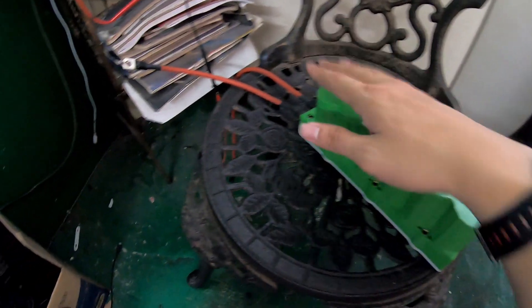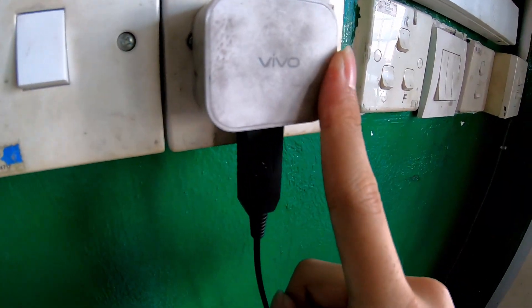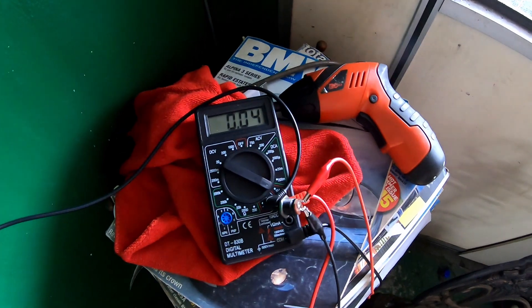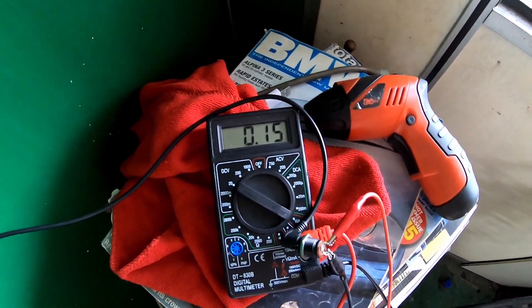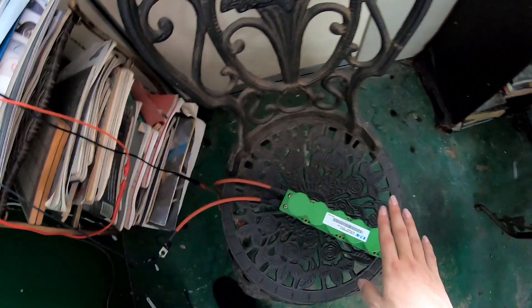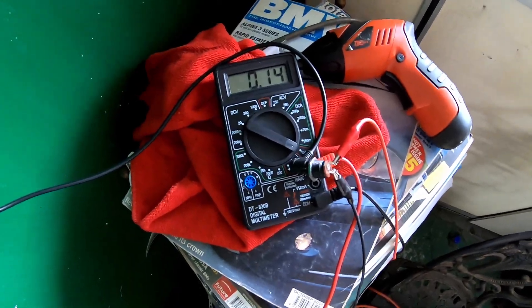To avoid heating of the cable, I am now pre-charging the capacitor before plugging it into my car. I'm using a USB charger that outputs at 5 volts and a boost converter that outputs at 10 volts. So I'm running 10 volts and monitoring the current — it's pulsing slowly. This will reduce the potential difference between my 12-volt battery and the capacitor. I don't want it to be at zero when I plug it in, so I'm pre-charging it to about 10 volts, making the difference just about 2 volts — hopefully to reduce the inrush current.